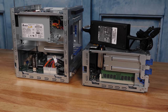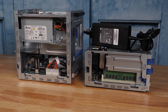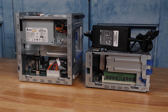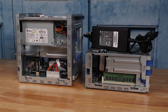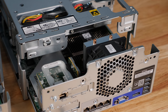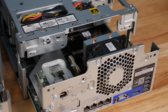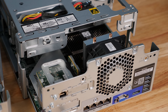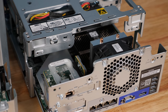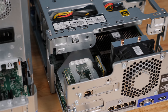At this point, you're probably going to notice that we're actually not showing the actual teardown. These units only have about four to six screws, and we kind of watched the footage and realized it was insanely boring, so we edited that out. The microserver Gen10 and Gen10 Plus have similar yet slightly different motherboard trays due to the design of the units. While the Gen10 Plus has an extra screw, we can remove the motherboard tray by removing only three cables on one side of the chassis, whereas the Gen10 had cables on both sides that needed to be removed.